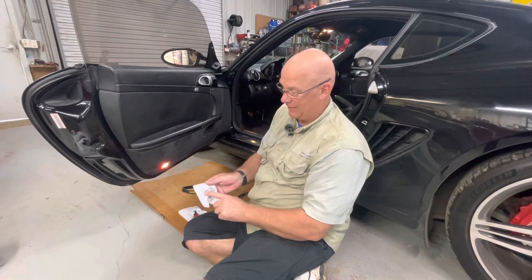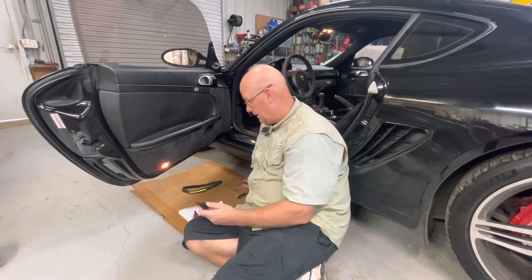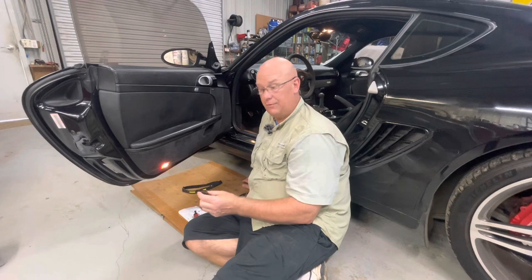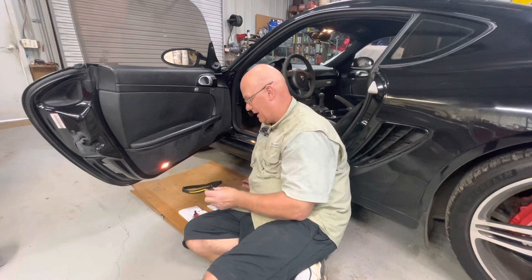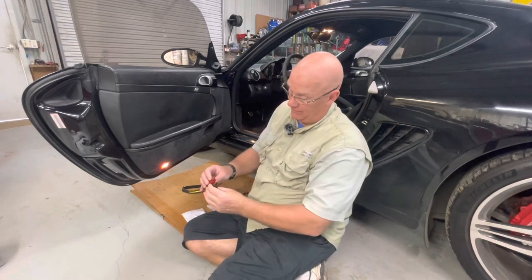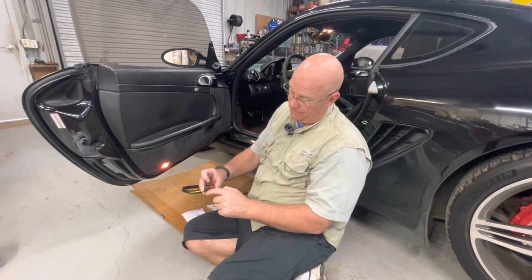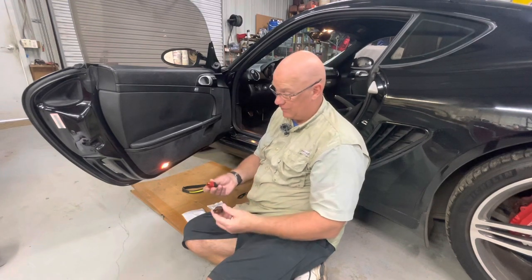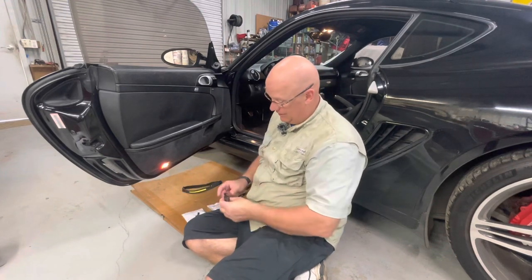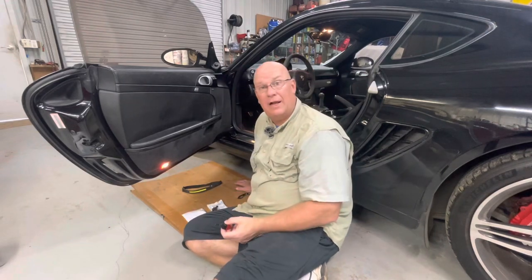The red and black one is for the clutch. The brown and black one is the exact same thing but a different color — part number 996-613-111-30-3. This is the brake pedal switch. It turns on your brake lights and tells the cruise control we're braking, turn off. As far as I can tell these things are exactly the same — same plug pattern, same attachment points, same little T inside. You could use one switch to do both, but Porsche saw reason to make this the clutch and this the brake.